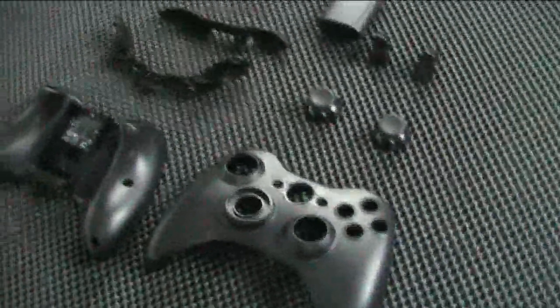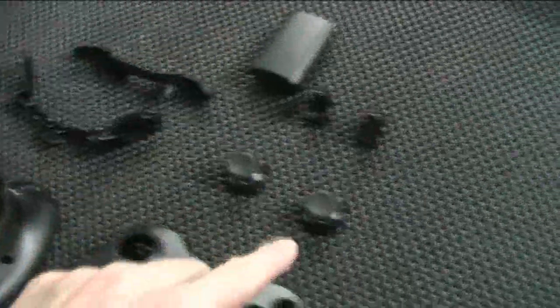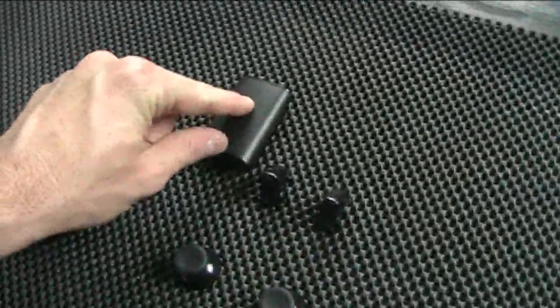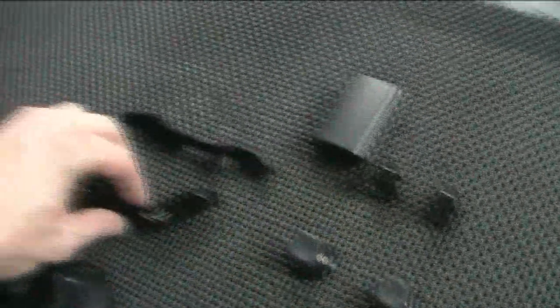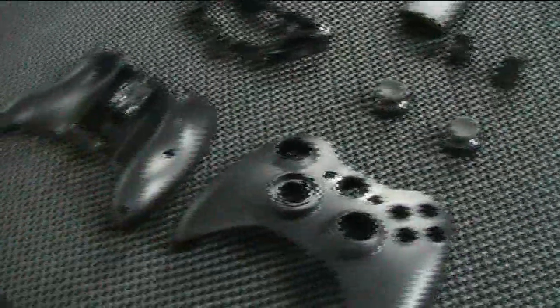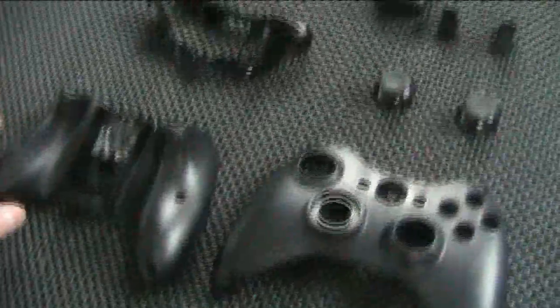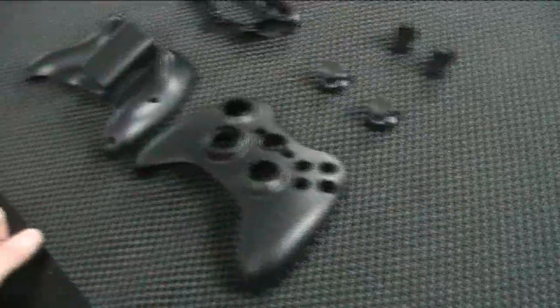And that's pretty much it for disassembly. Just remember: take your time, make sure you don't break any plastic, don't lose any screws or springs or anything, and keep all your pieces somewhere where they're not going to get lost. The pieces left to paint are the front, the back, the top, the bottom, the joysticks, the triggers, and the battery cover. Some of these are optional — the joysticks and triggers can optionally be painted, but they look really cool when they're a different color. Most things you see on eBay are just painting the main shell pieces and the battery cover. On to surface prep.